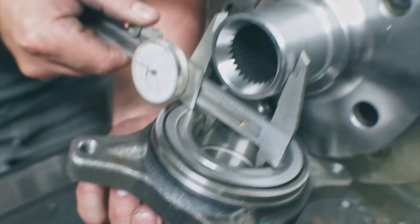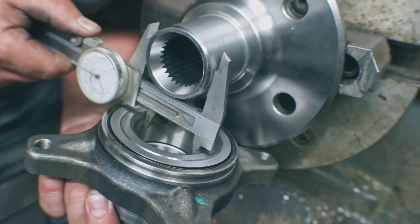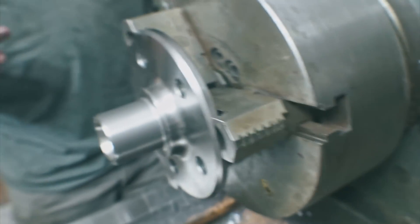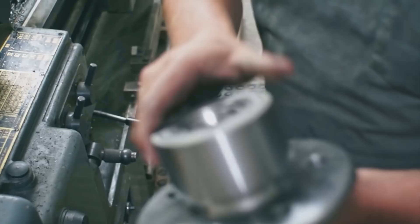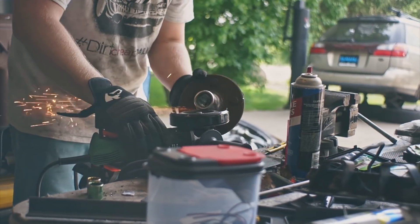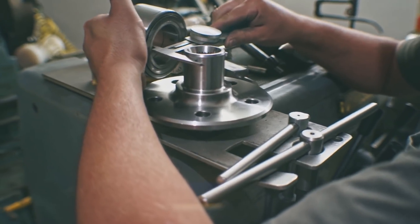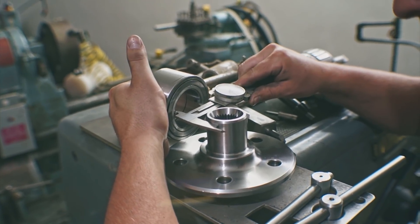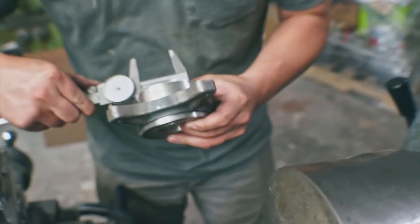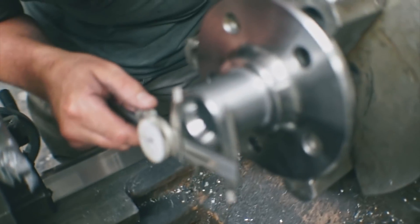The issue was to fit the hub in the wheel bearing. The only thing I could not find through all of my research for months, trying to figure out tolerances between a hub and a wheel bearing, was what that tolerance — the difference in size — needed to be for it to be the perfect fit. You don't want it to be undersized; the hub will spin in the bearing instead of the bearing spinning. And you don't want it to be too big — it can be slightly overlarge and you can press the hub into the bearing, but the bearing will basically eat itself because you're pressing in something that's too big, and you'll get premature bearing failure. I never really found any good information on what those tolerances should be.